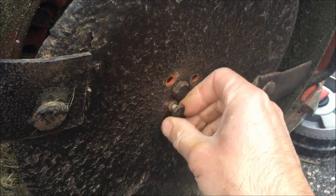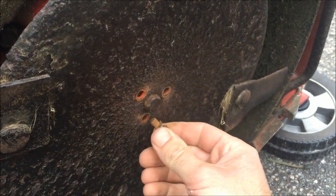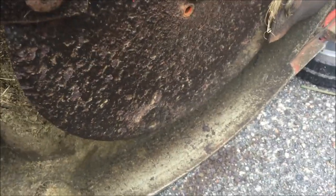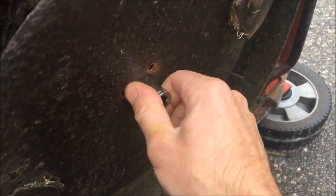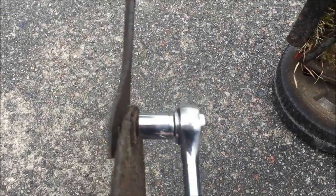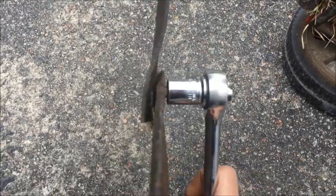To get the blades off — because the nuts are in behind — you take off this blade boss, or flywheel, or whatever you want to call it. What size is that? 7/16ths, and the centre one is 9/16ths, because of course it's Briggs & Stratton. I'm surprised this time — it's really rusty — but everything's coming off remarkably easily.